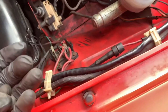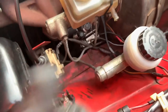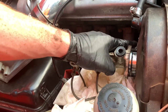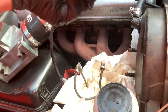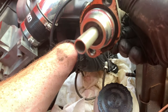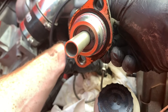I ran into issues where two master cylinders that I ordered back-to-back did not work. I had cheaped out on them and ordered them from a parts store online, and finally I ordered one that was proper for the car from Centerline Alpha. I didn't want any of the brake fluid getting on my phone, so unfortunately I didn't record me taking off the reservoir. All I used was a turkey baster to scoop fluid out, and then the rest came out when I popped it off of its grommets, which had already cracked and were leaking. That's why air was getting into the system and I lost all of my brake feel. You can see pretty clearly on both the master cylinder and the brake booster where the grommet had started to crack and dry rot. There's also rust and corrosion — you can tell the part is pretty worn, all of that from brake fluid leaking out.